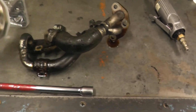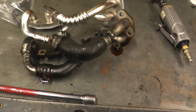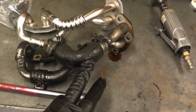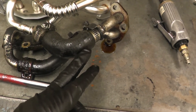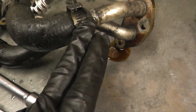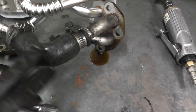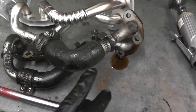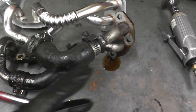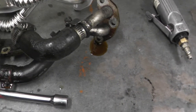Here are the two parts side by side. The new one is upgraded — it's a metal pipe. Here's the one that came out. The top one is the one that originally leaked. We tried a temporary fix with a hose, but you can see how much it's swelled up. If you ever use a hose, make sure it's an oil hose — a coolant or antifreeze hose will swell up with oil. This part is not that expensive — about $80 Canadian — so if you're going through all this, put the right part on.